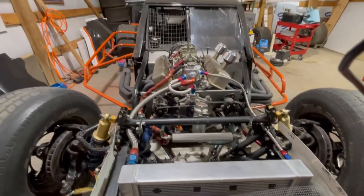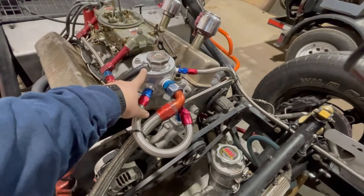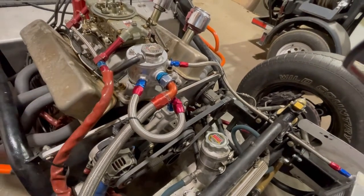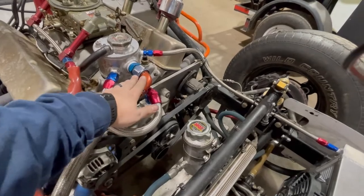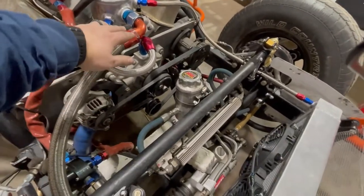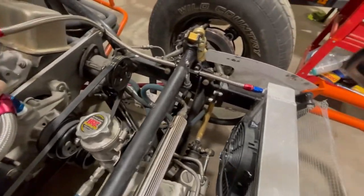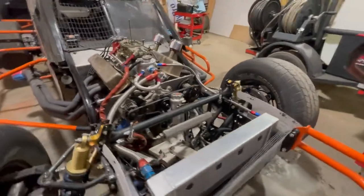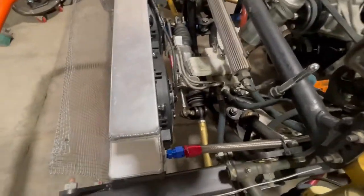All the hoses are run now - got everything hooked up to my radiator. Looks pretty nice. Went ahead and cleaned everything up using zip ties to tie everything together. You can see we've got the expansion tank bolted down, the overflow hose so if the car heats up it sprays the excess overflow out that way, and a new return line to the water pump. I took this line that was really long - probably twice as long - cut it in half and ran it a shorter route to the top of the radiator.